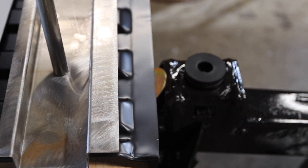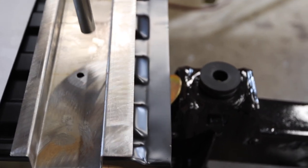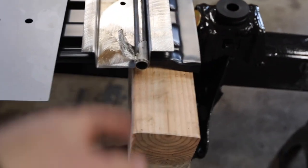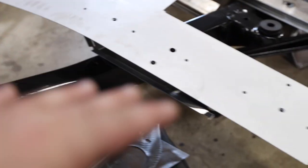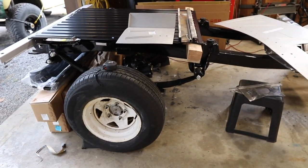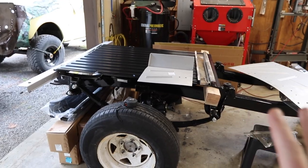This piece here is the one that sits on top of that body mount. On the Bronco it's got a riser tube there that keeps you from crushing when you clamp down on your body bolt, and I think that's necessary. Even though this one doesn't have that, I'm gonna go ahead and weld it in with some tube stock I had around the garage. Just getting a feel for how it all goes together. I think referencing the old body while I build the new body feels right. The main thing is just make sure that bed is square.